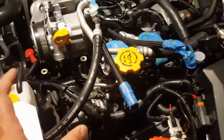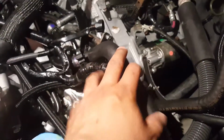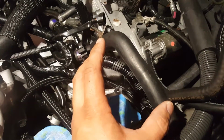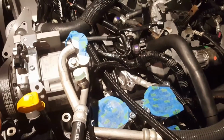So the pump was here, and ideally you have to remove the pump and all the plastic stuff at the bottom or the back, and you arrive at the back of the manifold, which is typically here. You remove the solenoid that contains the barometric pressure sensor. You get rid of that, you do whatever you need to do with it, and that addresses this side of the engine, the driver's side head.